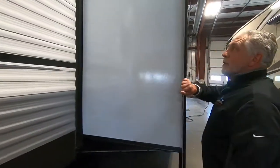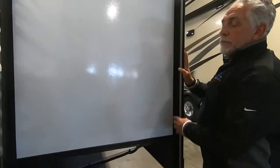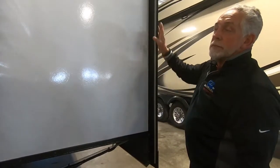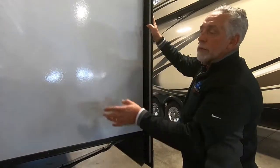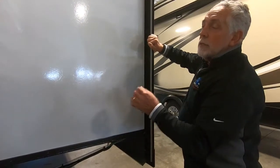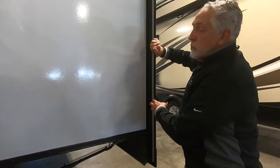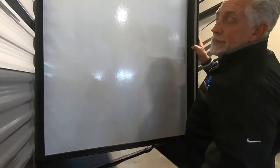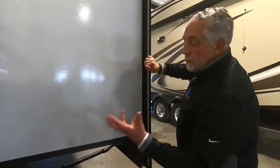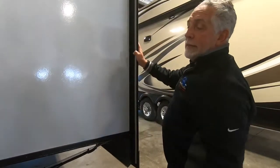The next thing is your slide room and the slide room seals. Slide room seals are rubber, so like any rubber product, if they're exposed to a lot of sunshine — especially in places like South Florida, Texas, or Arizona — it will eventually make them brittle and affect the integrity of your seal. We have a product called slide room seal lubricant. Use that about once a month during the summertime or when it's sitting out soaking up sun. That keeps them pliable, keeps your seals in good shape, and keeps the weather from finding a way inside your camper.